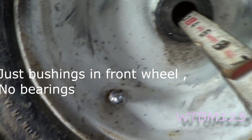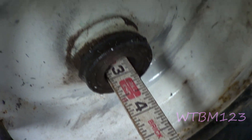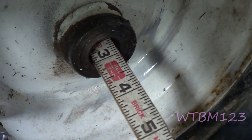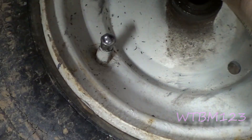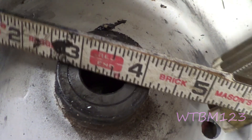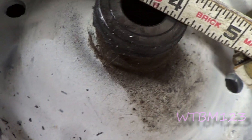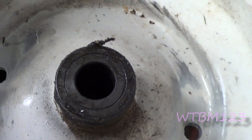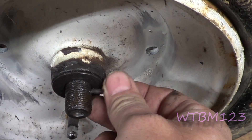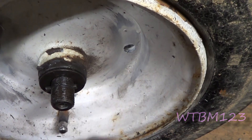Holding it flush, the hub is three inches long and it's a three-quarter inch hole, just in case you're wondering. It's a three-quarter inch hole and three inches. Flat washer, pin, then the nut with the slots.